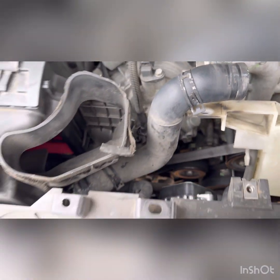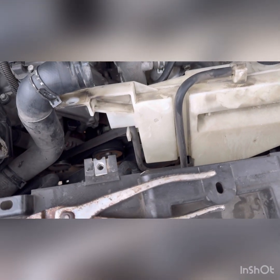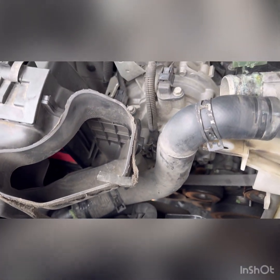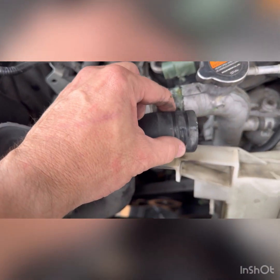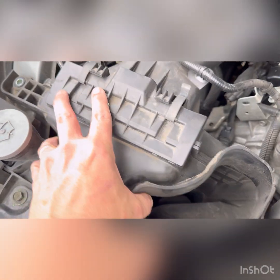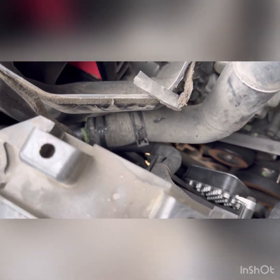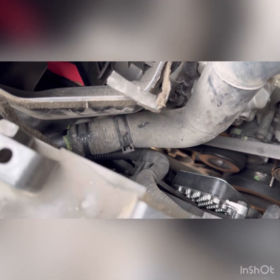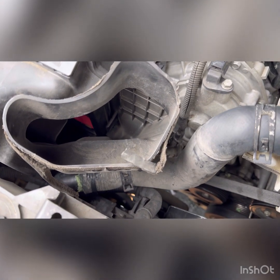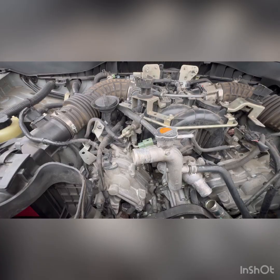All right, guys, I'm moving it along a little bit. Got the little housing, the collar there, cleaned. I'm gonna take off the upper radiator hose. I just basically took off the clamps, moved them down, the ones that were down there. I loosened the bolt for the airbox, so now I have a little bit more room to get to the clamp. Simple enough. It doesn't have to be removed or lifted out. Just leave it there in place. And now I'm just gonna simply remove the hose, and I'll put this one on since it's the easiest one after I clean up this guy right here.